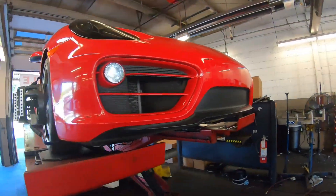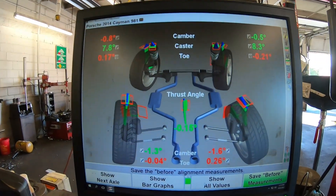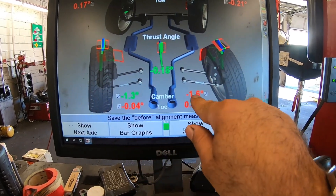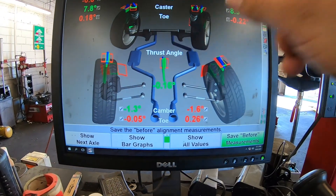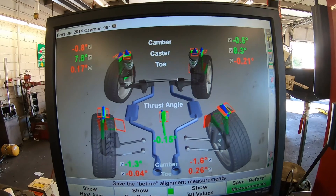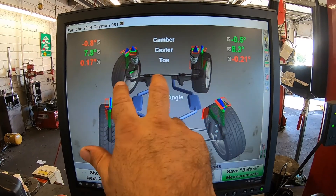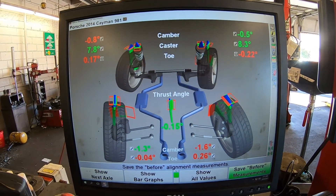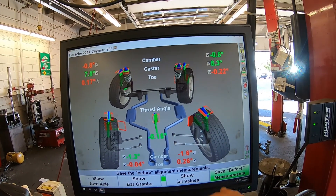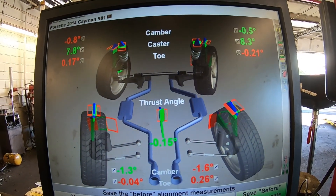The car is on the alignment machine and things are not so far out of whack. The back needs to be adjusted — cambers are close and it looks like it can be fixed easily with an adjustment. This is also kind of the test of after straightening everything. The tie rods I put in the front I just put in randomly, so we'll see how we get it. This is the first setting and we're going to see what the end result looks like.